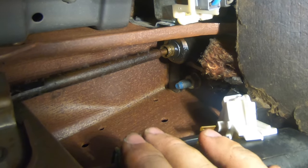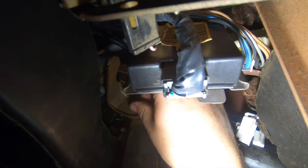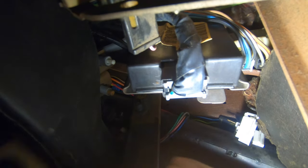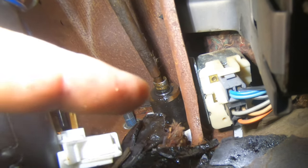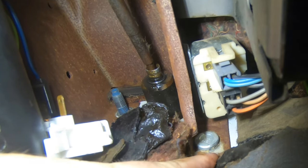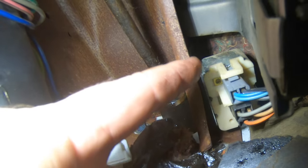It could end up ruining the complete carpet of this car. Next up is to remove this bolt before we get this bracket out of the way. Then we can take the clip off that holds this rod. This bolt right here also comes off, and in addition to that one over there, there's one up behind this relay and you can't even see the bottom of it really up there. But we have to get this relay out.